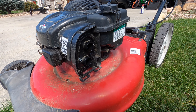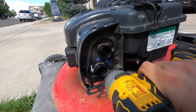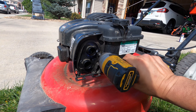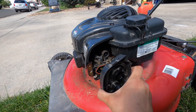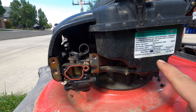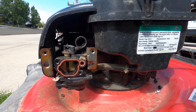Take off your air filter cover, pull off the air filter. You're going to get a 9/32nds nut driver — actually for these we've got to switch over to a 5/16ths nut driver. That's going to let us pull this off. We're going to end up taking this carburetor out of here, but first there's a fuel line from the gas tank to the carburetor. If you've got gas in your tank like I do, you might want to do something to stop the flow of the gas.